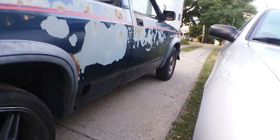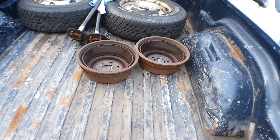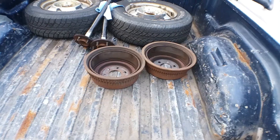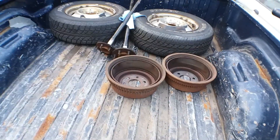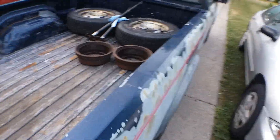I think these look better than RT wheels anyway, and I don't need real truck wheels because this thing's not going to be used to pull or tow anything heavy. That looks good, I'm so happy with this — it's kind of a huge relief to have this part done. Now I have new tires and the thing's a lot safer to drive. Five-lug swap on the Dakota: everything bolted in just like it was supposed to as a direct swap, just using earlier Dakota parts — axles and drums from an '88. Ordered parts for a '90 but it's the same. Fresh diff fluid as well. Just axles and drums and you can bolt them in. That's going to be it for this video guys — hopefully this has helped a few of you who have Dakotas and are having issues finding wheels that fit. Five-lug swap, five-by-four-and-a-half — you can run all kinds of different wheels that way.